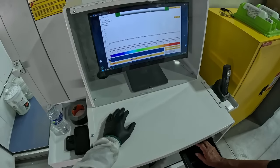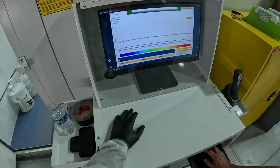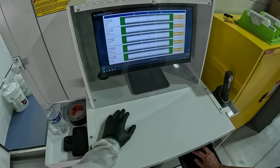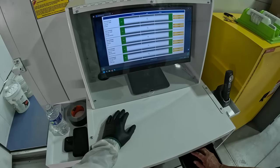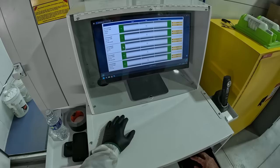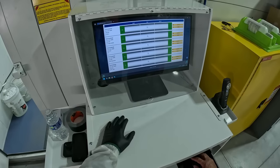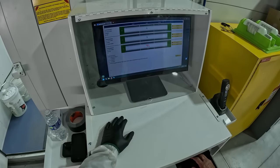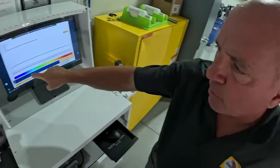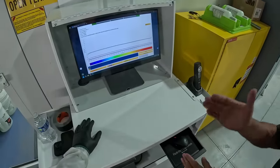And the blue is our target. Okay. So we can hit this. Look at a different one. This is an 87. It starts off at a 94. But sometimes you might find a better color match down here with a lower number. It just depends on that spectral curve. So that line is what you want to get tight. You want to follow that target line as close as you can without crossing.